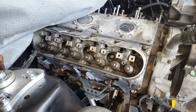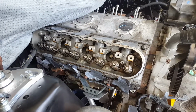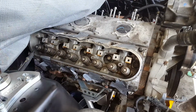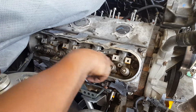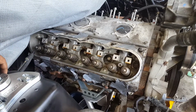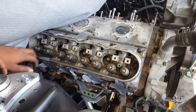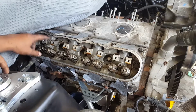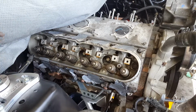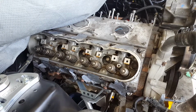And it all looks good, and it just really puts into perspective how hard it is to take off the cylinder head. Like, it's on there good. It's part of the motor, you know, torquing down each of these bolts to 75 foot-pounds. That's almost as much as a lug nut, and it's crazy. But anyways, I'll get the push rods that I labeled, and I'll put them all in there. Hopefully you labeled them too. Get them from my push rod stack here.